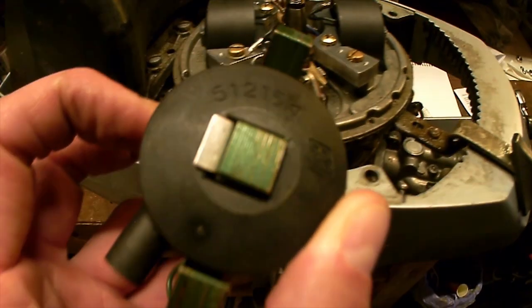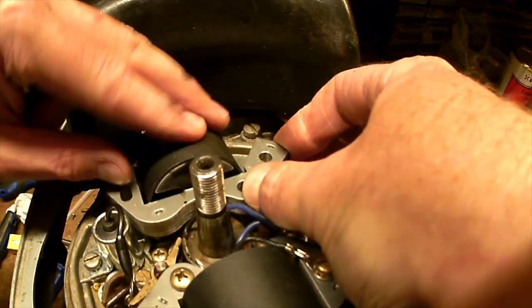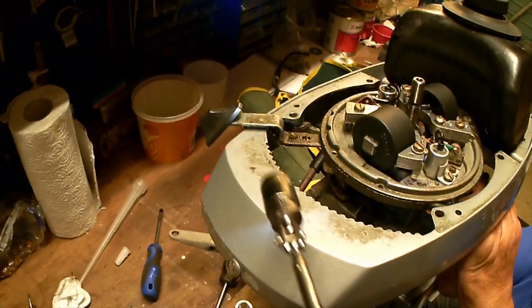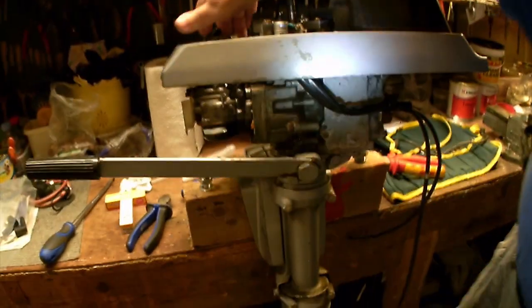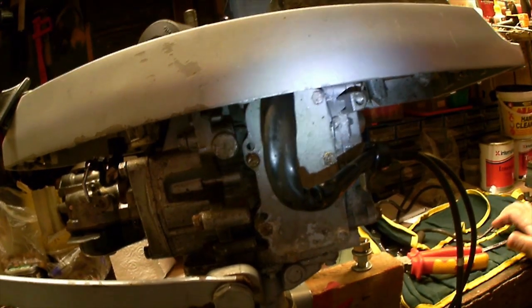Here's a nice part number for you — it's 512154. That's the part number. That's back in place. Now I'll just re-screw all of these in place. This blue wire, which comes from the bottom — keep it away from the rotating parts, because all this rotates and you don't want that wire rubbing on that, it will just break things. What we've got happening here is we are clamping in the HT leads. We've put it all the way over to full throttle, which has moved the maximum length of the HT lead around the magneto, and then we've clamped it at maximum so that we can shorten the lead by moving the accelerator backwards. You can see it's now still clamped and bendy.